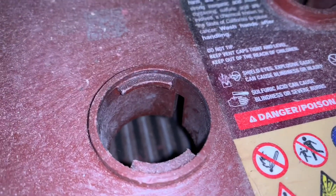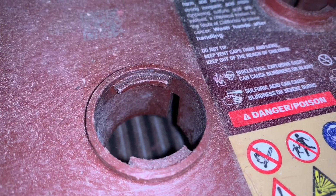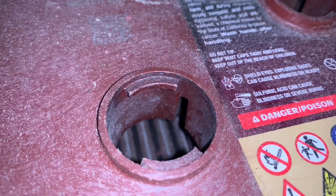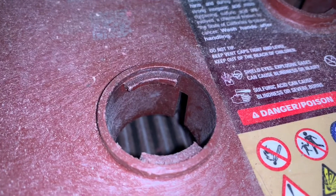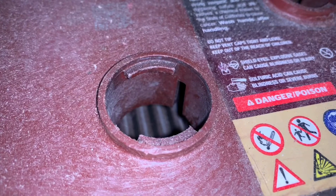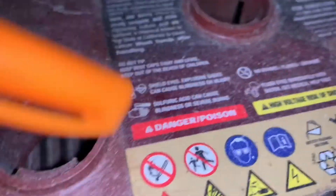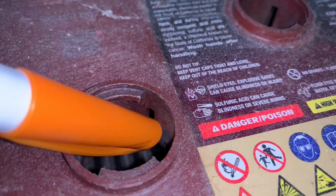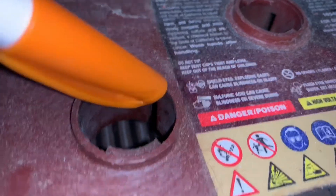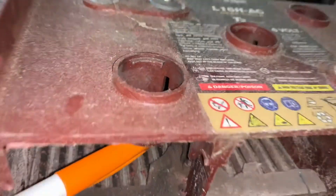There's been some confusion about how far to fill this up. On the newest instructions glued on a card on the battery box, it says a half inch below the liner. We've cut this battery in half so we can show what we're talking about. Half inch below the liner is not a half inch below the top edge — we're talking about below the liner, which is this plastic piece hanging down.